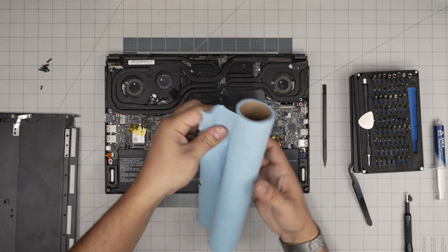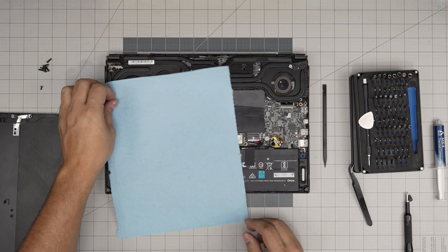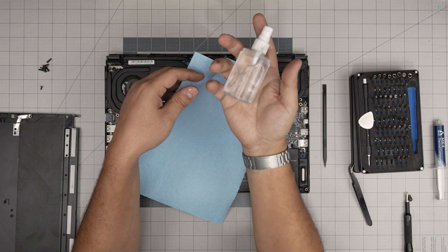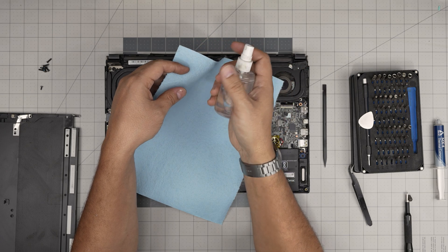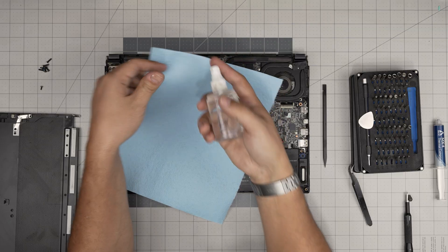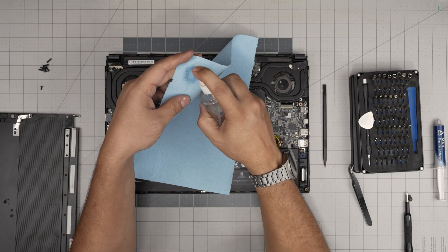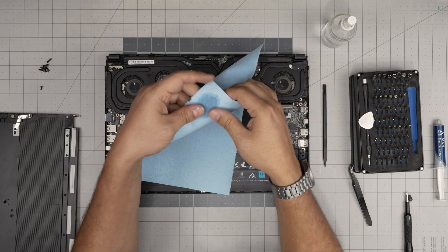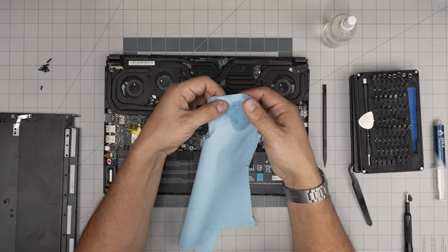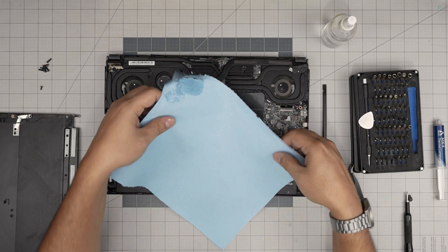Take the cover off and use a toothbrush to clean it. An important supply is one sheet of workshop towel. People always ask: can I use a microfiber towel? I always say no. The reason is isopropyl alcohol — use 99% or 98% only, never 70%, because lower concentrations contain water and you don't want water on your components. When you soak the workshop towel in high-percentage alcohol and clean the motherboard, it won't rip apart and will prevent damage to the board.